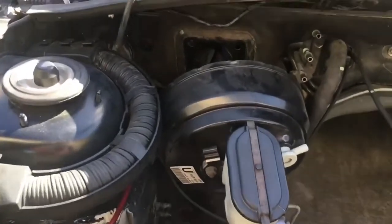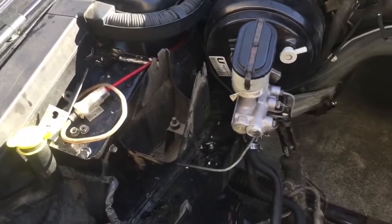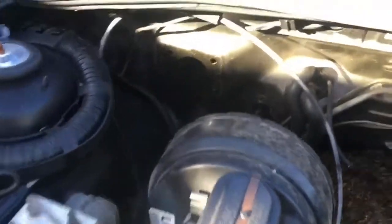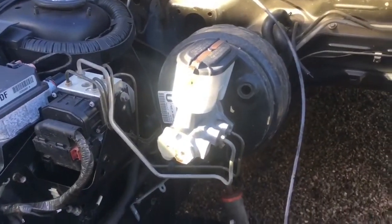Back inside - pulled that shaft off, no dramas. You come back out here and you've got to pull the booster out. All my brake lines are still hooked up. Pull it back far enough because you're going to have to get the brake pedal off over the shaft, so you have to bring it back a fair bit to give flex in the brake lines. This isn't an ABS car, just executive, so there's no ABS lines. But actually there is more play to move the booster back with ABS lines - with my ABS wreck I could pull it all the way out. So ABS or not, you'll be able to do it. If anything, ABS is easier.